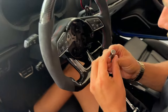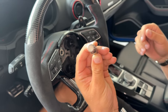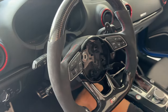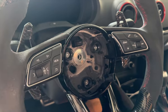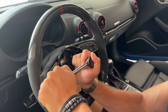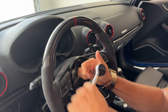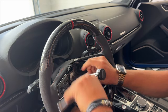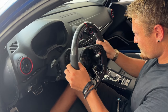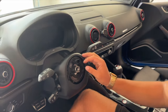The next thing you need is an M12 or triple square bit and a 13mm socket. There's a bolt right here that needs to come off — it's really tight but you stick it in, give it a good crank and it'll come out. With the bolt off you can pull the wheel lightly and we now have the steering wheel off.